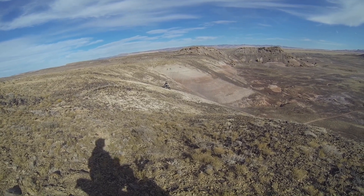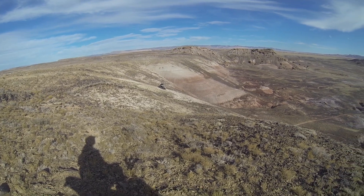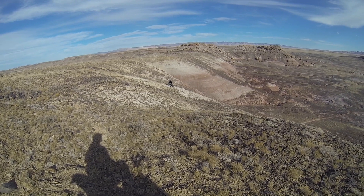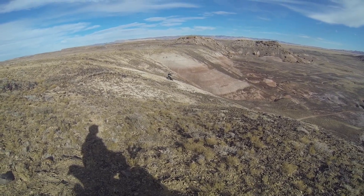So that's the one drawback I've experienced riding that Beta 300 — it does not have any top-end power. It's all low-end and mid-range and then it completely runs out of power on top because it doesn't have a power valve.